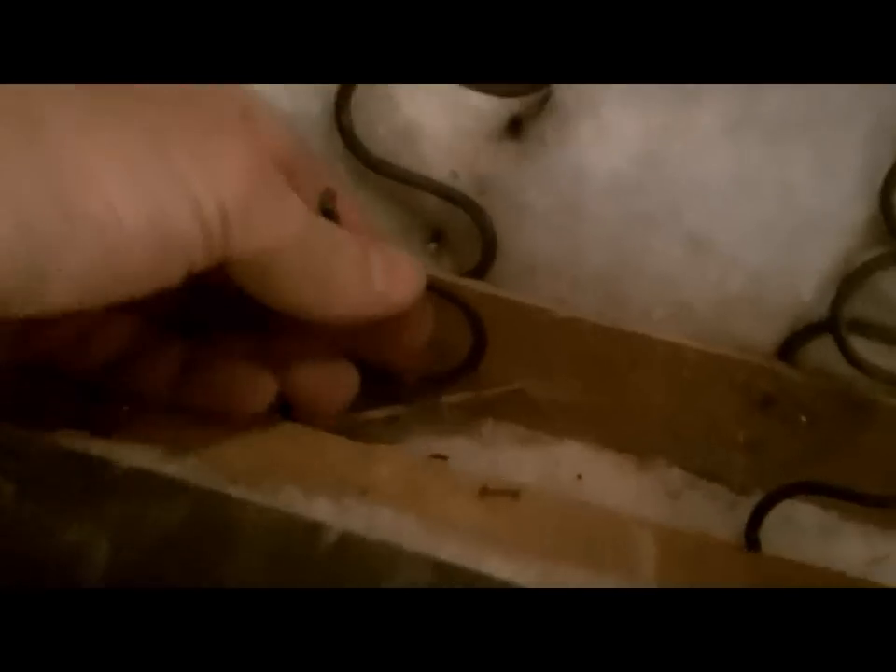The good news is I figured out what's wrong. Look at the screen — you see this wire? It's intact; all of these pieces are intact up to here where it breaks. At the end, attached to the front of the frame, is an S-clip that attaches there. These are all good. On the left side, you can see one is broken — this one should be attached right there, and this wire is broken. So we have one, two, three of those broken.